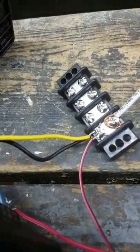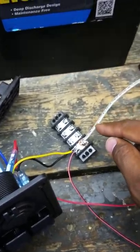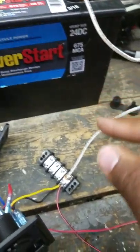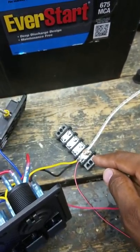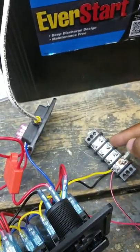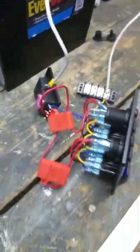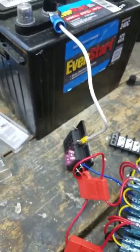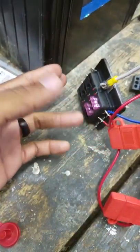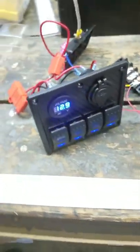As you see, I got my yellow and black down to a negative. I'm going to end up buying a common bus bar — that's where, when I hook up my 10 gauge wire to my negative terminal, I have a common bus bar which, as soon as I connect it, will run that negative straight through that entire thing. So these are individuals right now; I'm going to replace that. But for demonstration purposes: 10 gauge wire in to fuse block, which pushes power to anything else I have attached, which is attached up to the switch panel itself.